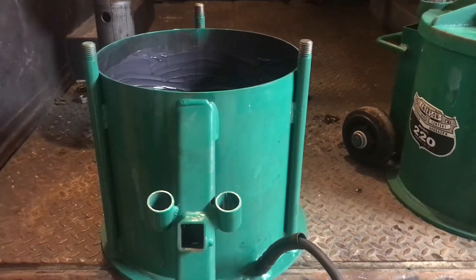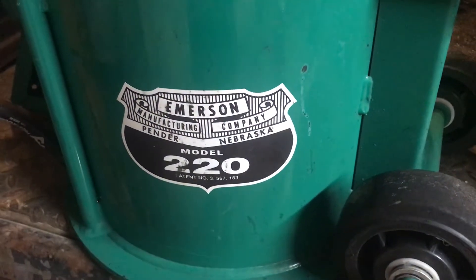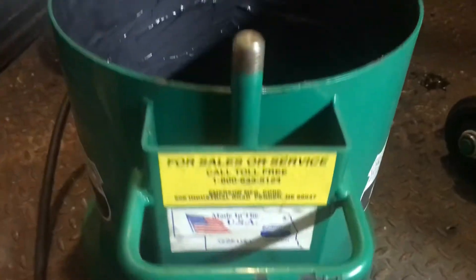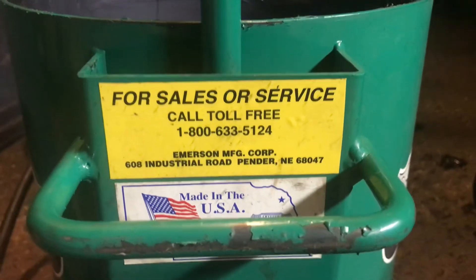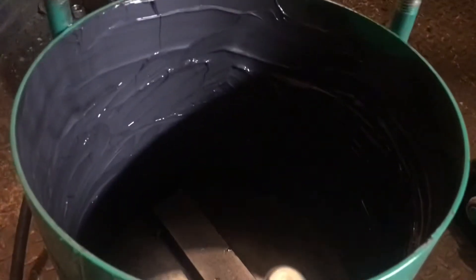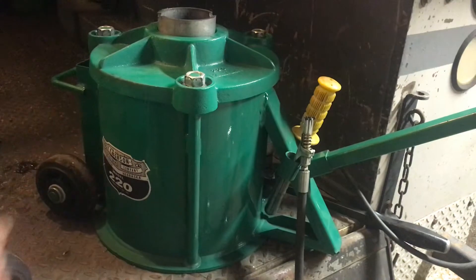We put blocks of wood underneath the lift axle and lowered it, and that was just enough that we could get the other three axles off the ground because it had a broken leaf spring. These things will pick up almost the back half of a loaded chip trailer. Truck and trailer were running about 104,000 pounds with a day cab Mack on it. Anyways, these are the Emerson frame jacks and they have two different models - the 220 and the 110s. They're made in the US, which is awesome, and they're made extremely well. The shop that both of us worked at before had a pair of these things that were probably 35 years old, used on a daily basis, and they held up great.